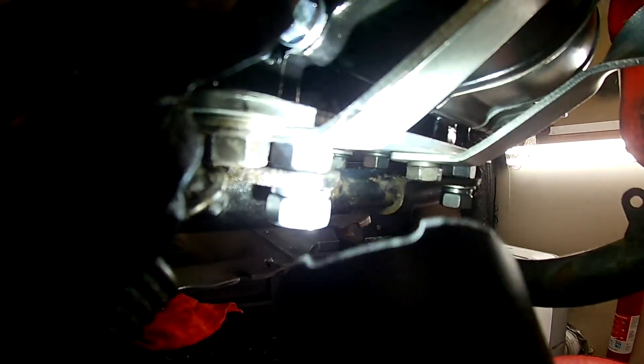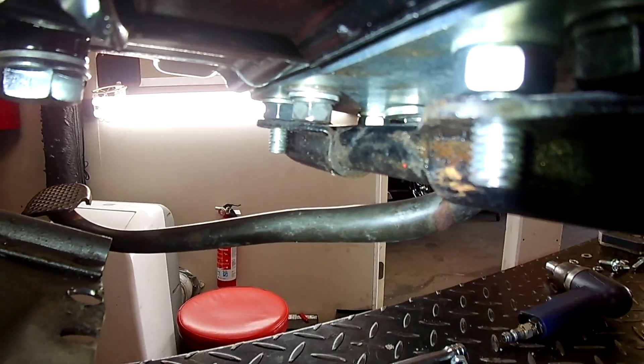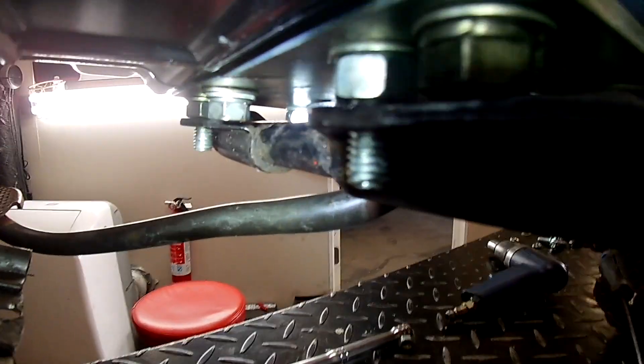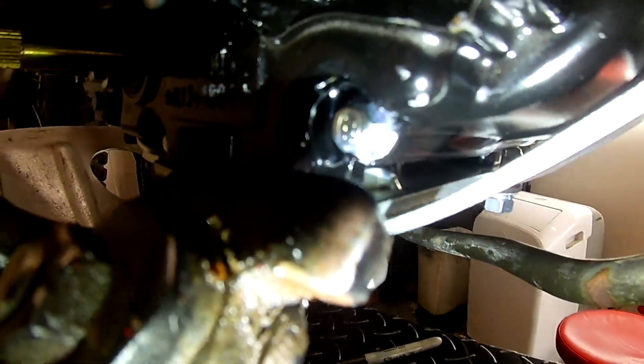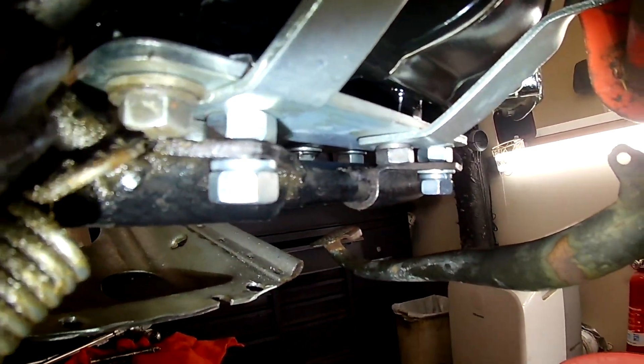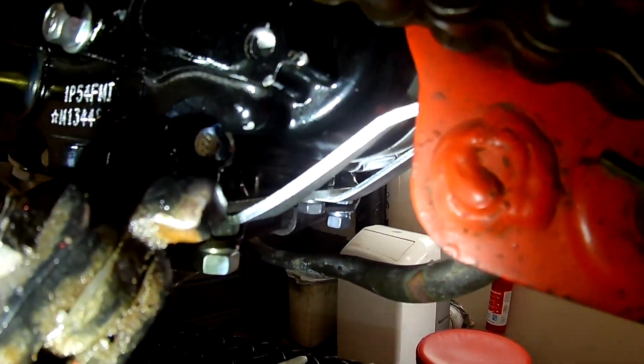Because I had to do that and tighten it down with a nut, that's why I put nuts on the bracket before I put the foot peg bracket on, to space it out. There are spacers that come in the kit and they go in between those two little brackets, and the spacers get sandwiched between — that's what holds up the bottom of the motor, because this motor mount doesn't line up. You have to have this kit to make it work.